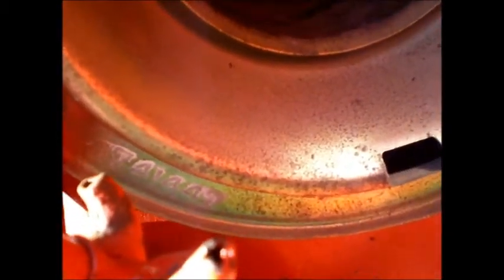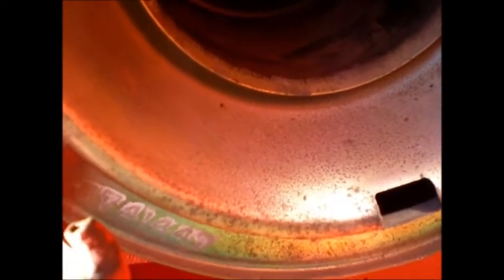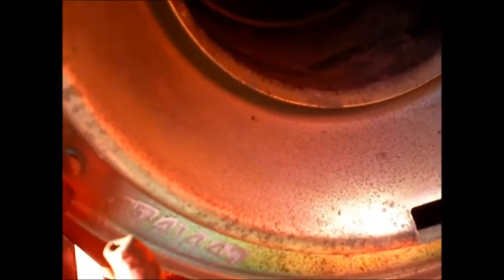And as I said, they're all labeled. I don't know if the camera's picking up on it. The numbers are inside there next to the connectors. Makes it real easy, even though the connectors are all the same. Like you could plug a 17 into 18 when it's not supposed to be done that way, and vice versa, or 16. The 16 is your ground, or some people like to look at it as a 91. If you look at one, you'll see why, but it is actually a 16. And then it's grounded to the frame, so if you had to replace that, you can look at that, make sure your grounds are good and all that.